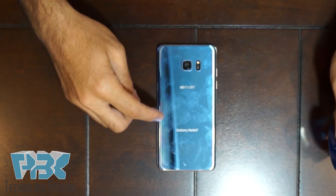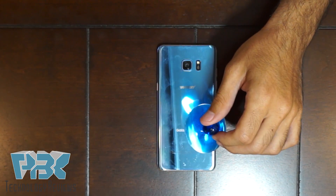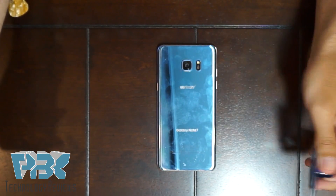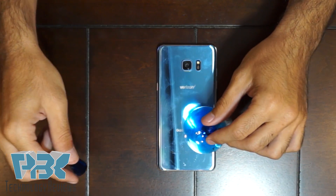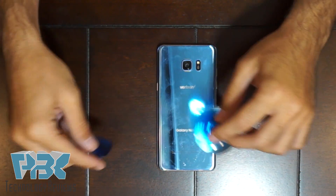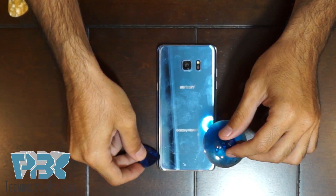You're going to have to be careful so you don't break the glass. You're going to need a suction tool and also some sort of pry tool — I use guitar picks. You can use whatever you prefer, but keep in mind anything metal or aluminum will damage the frame of the phone, so stick to something plastic. You could also use some business cards to help around the edges so you don't crack the glass.